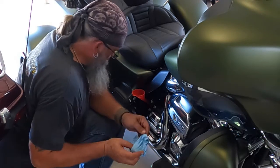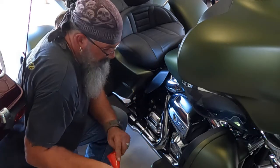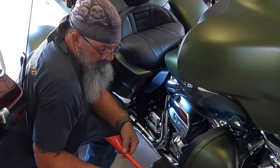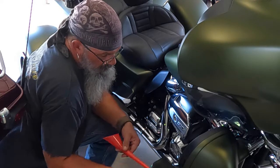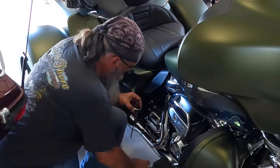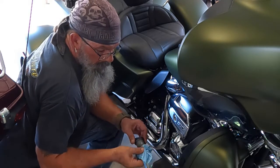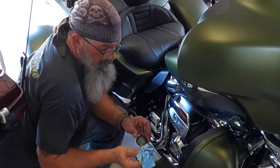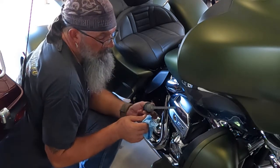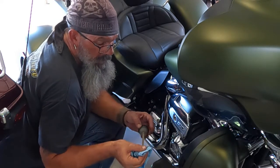There are our four quarts in. I'm going to close this up, let it run for a little bit, and come back to check my level and make sure it's good. Then I'm going to inspect my air cleaner and see if it needs to be blown out — I've probably sucked a lot of bugs into it, but I haven't been in much dust. If anything, I'll use some light air pressure to blow out any dust and get it cleaned up. Every time you pull this drain plug out, check your O-ring and make sure it's good to go, because it would suck to have a leak coming out of there.